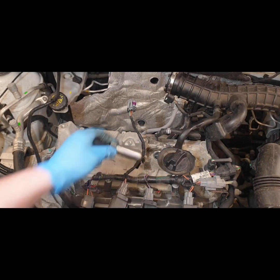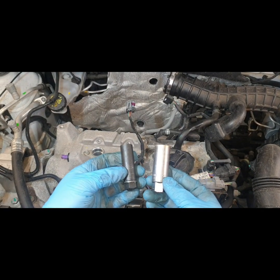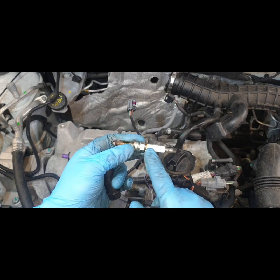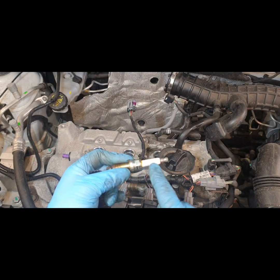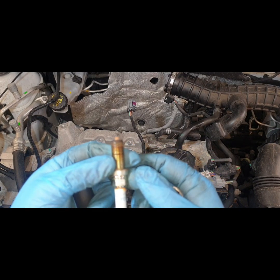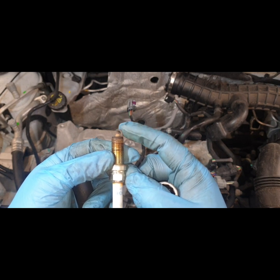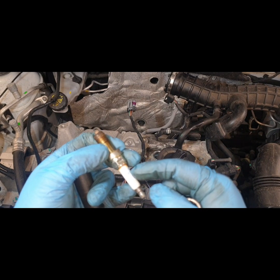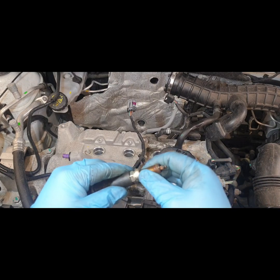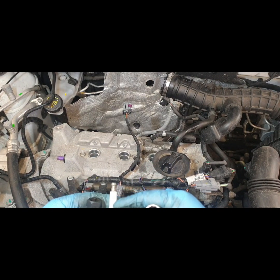As you can see, the bigger socket will not fit down into that hole — the smaller one does. The difference between a spark plug socket and a normal socket is that on the inside it has a bit of rubber to protect the ceramic. You want to make sure you do not crack that ceramic or bend the electrode on top. You can see the air gap there — don't just drop it into the cylinder as it can bend the electrode. If you bend or crack the ceramic, you'll get a misfire. This socket has a little grabber inside so it holds the plug and won't drop out.